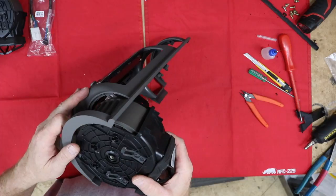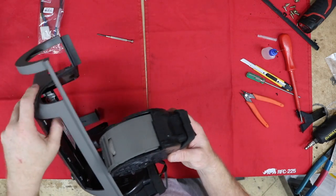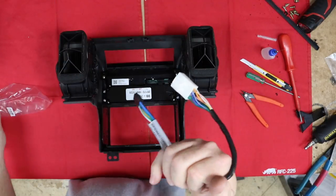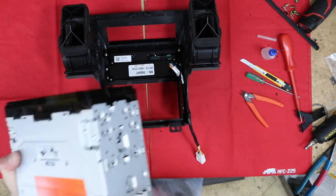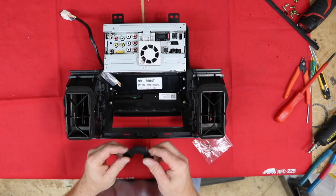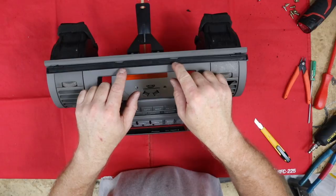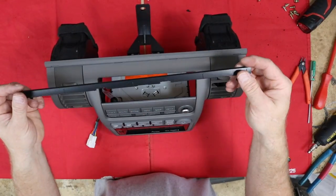Now go ahead and put in the AC vents. In case you forget which one goes on which side, these guys here are always at the top. Go ahead and plug in your AC controller wire. If you actually had the pocket, you want to do this before you put the pocket in. Now we can go ahead and get the radio mounted. This piece here mounts just like this — that's what the bag of two screws is for. Because this is basically falling apart, we're going to add two little pieces of double-stick tape so it stays in place. A lot of times it will stay in place just because the dash hangs over it, but we like to be sure.